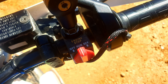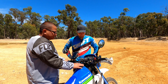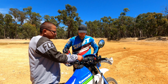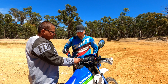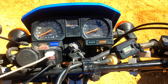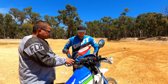It's only done 2,800 kilometers — yeah, it's a 30-year-old bike with 2,800 kilometers plus 138 hours. It's never going to be sold so resale value doesn't matter. The other thing is just a 12-volt plug for repairs and stuff like that, an air pump, a USB charger — all from AliExpress — and it's got a voltage readout, which is very important to me, with a switch on top. The idea is if something goes wrong with the alternator, I'd see it before I dip into the battery and can return to civilization.